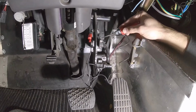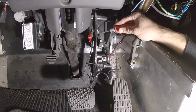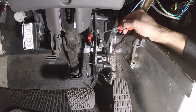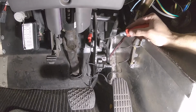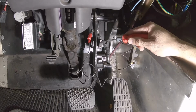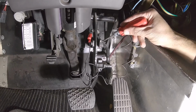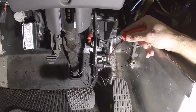So you have to connect the brake controller on this end right here. In order to do that, I should probably take that. I gotta figure out where I want to run it. But that's your cold side, that's your hot side. And on the instructions, it says for the cold side right here, like I was saying, this side isn't supposed to see a ground at all.